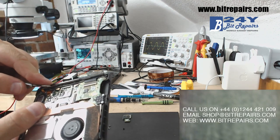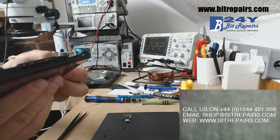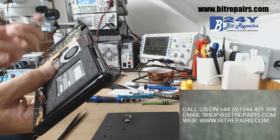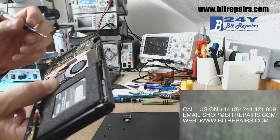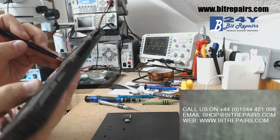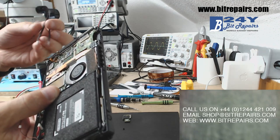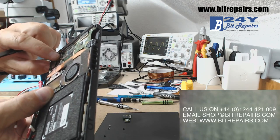Here we've got a little antenna connector — that can come out, go to one side. This one down here was for where your controller goes. There's also one on the opposite side — we'll take that one out at the same time. We know that one just flicks up, and then we pull that out. Just be very careful with all of these ribbon cables — pull that one down, that's another cable out.